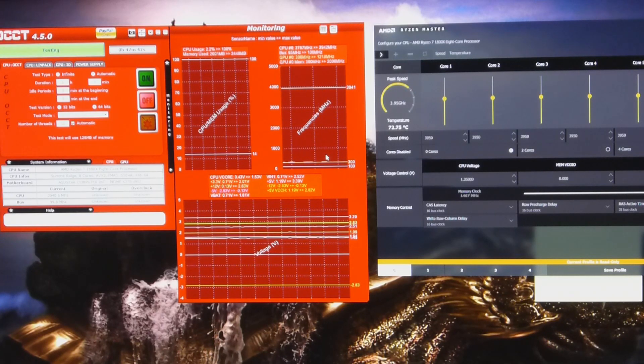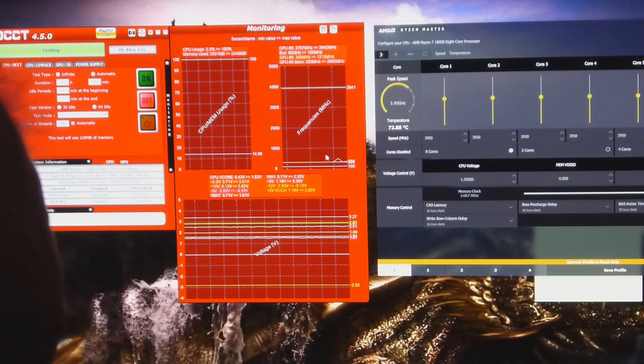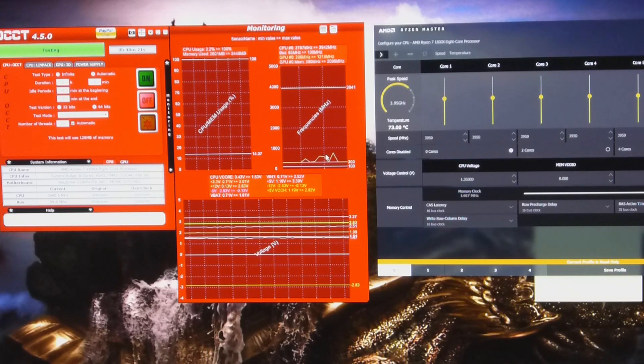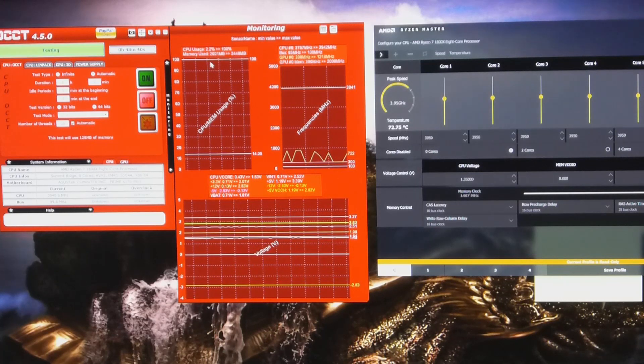I've just run a nearly 48-minute stress test with OCCT — seems quite stable. It does seem to be running ever so slightly higher V-core than before on exactly the same settings, about 0.02 to 0.03 volts higher. Be aware of that — it does seem to be riding higher on V-core for some reason. But so far I have the same overclock and it's just as stable as it was on the previous BIOS. This is Aussie Bogan Tech signing out — please like and subscribe, have a nice day.